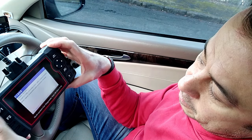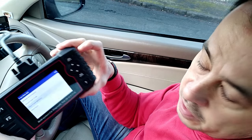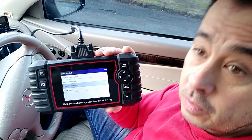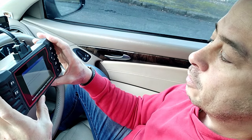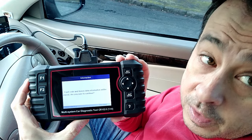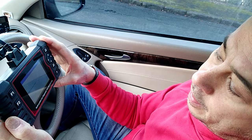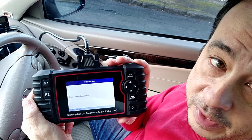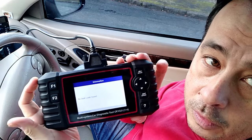I'm hoping if I clear these faults - and I'm going to show you how to do that - they'll then stay away. So I'm going to press back and press Clear Fault Code. Now, whenever you do clear a fault code, obviously physically make sure that you've fixed whatever you're doing. There's no point just clearing it and thinking it's going to go away - you've got to make sure you physically resolve the issue, then clear the fault code and see if it stays off. The warning comes up: fault code and freeze data information will be erased, are you sure you want to continue? The option is F1 cancel or F2 OK - I press F2. Erase operation done. If there were any problems it would say failed, but it's erased it. So let's go back and see if those codes have remained away - reading fault codes again. I had eight of them. No fault code found.